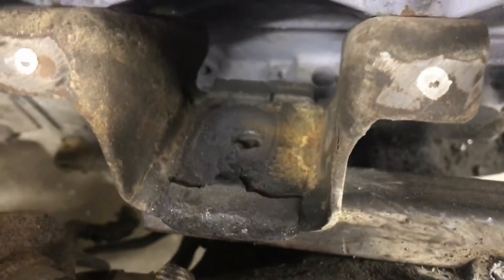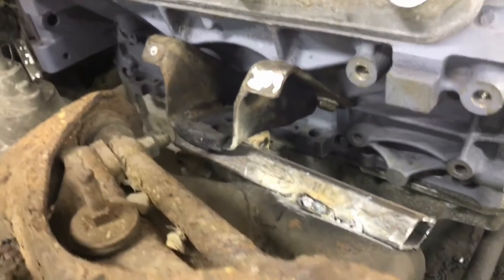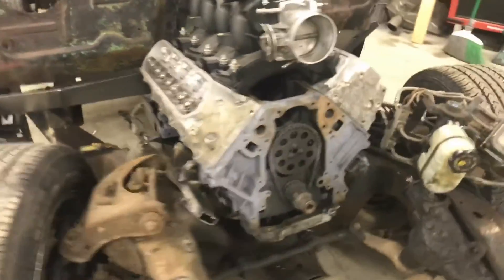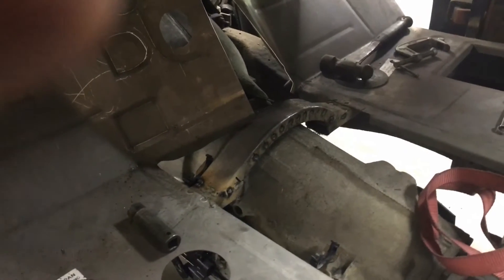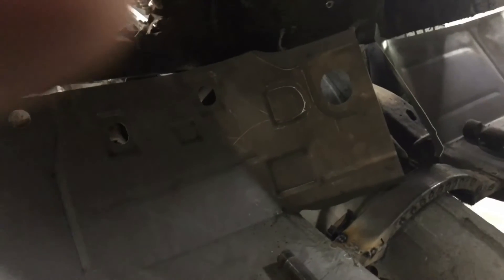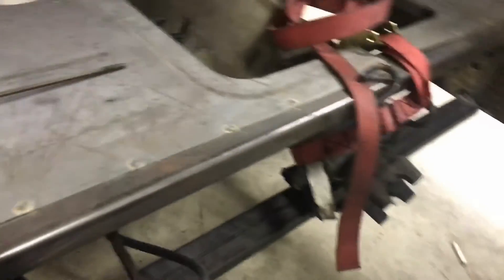There's an angle piece welded on there, and that hole will have bolts going down through it. I may put some thin rubber isolators under there — not sure yet. Once everything comes back out I'll finish weld all this and make it look good. I did hump that floor — it's a big tranny, needs a little bit of space. Now I can weld the front of these floor pans up and shape that tunnel. I made a cross member that's more or less tacked in right now, and it is bolted to the tail shaft of the tranny.